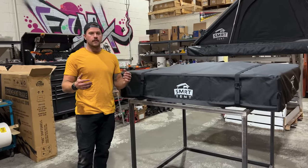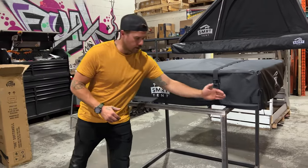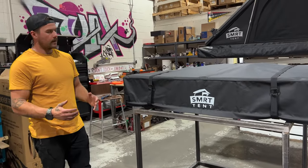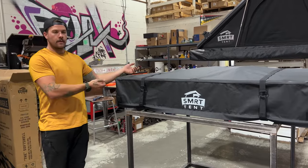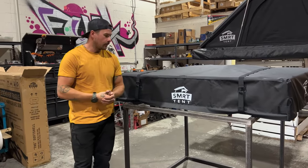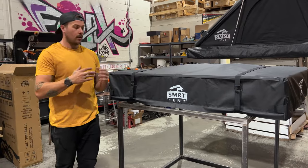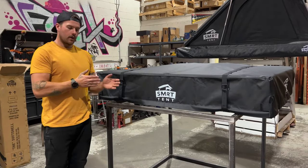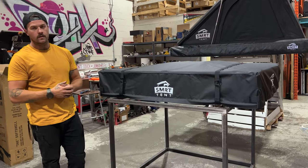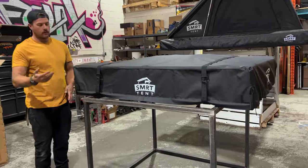For installation purposes and the purpose of this video, we're going to pretend this rack is actually on the vehicle — these bars here are your vehicle's crossbars or your truck bed rack. When you're lifting it onto the vehicle, it's best to go from one side and have somebody on the front and back. Lift up and on from that side instead of everybody trying to lean over the back and walk it over the front — you'll hurt your back. This way it'll be a lot smoother and a lot faster. One thing to note is we want to orientate the tent. I personally choose to flip mine off the passenger side of the vehicle — that way, if you're pulling over and need a snooze, the ladder and rest of your tent is on the non-traffic side, keeping you safe for a roadside snooze.